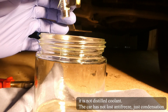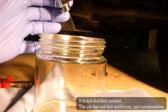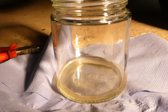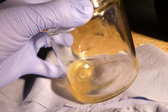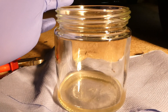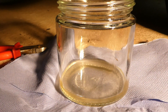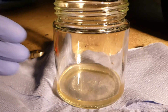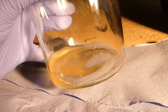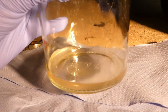It's almost nothing. It's a bit of a yellowish fluid, mostly water. I've been driving in a lot of humid weather. There's been quite a bit of rain recently, so it's mainly condensation. But we'll probably start collecting more as the weather becomes hotter — it will collect a higher proportion of oil than just blow-by gases.